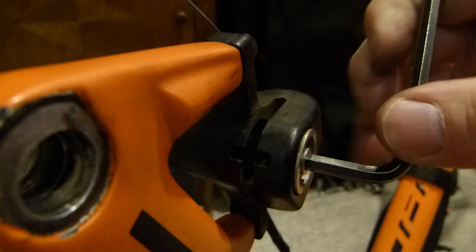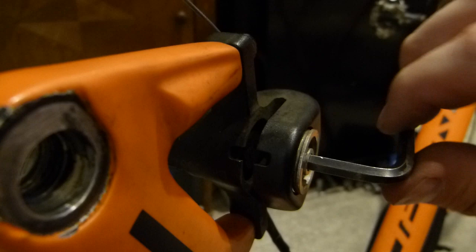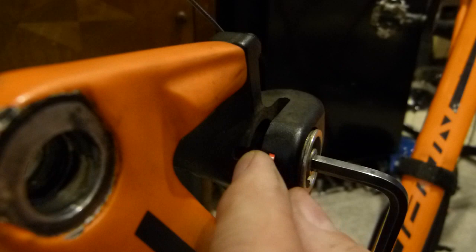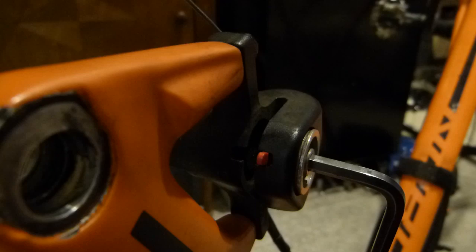It's gonna be sounding like this, because the thread of the piston and the thread in the caliper get the brake dust into it. So there's really nothing you can do about it. Put the brake pad first into this half of the caliper body, and it's gonna kinda wanna stick in there, but you can help it with the tweezers. Now it's neatly in place with a nice and even gap. It's fully in place. Viewing it from above would reveal a slight, let me just raise you up a little bit, thereabouts. It's not really from above, but it's good enough for what I want to show you.